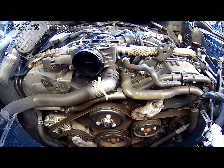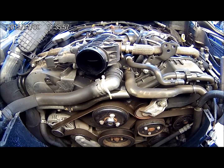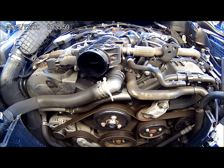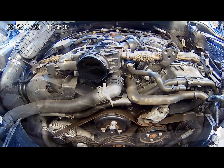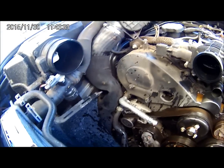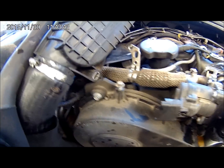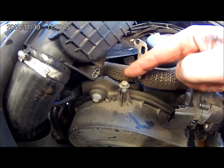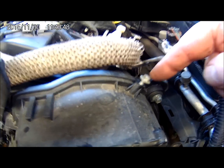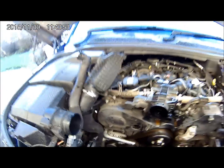I'm going to start removing all the cooling hoses now. You will lose fluid here, but don't worry about it — it's easily replaced. I haven't actually removed them completely; they can be disconnected on one side and just pushed over out of the way, which saves you getting things mixed up. There are also a couple of small brackets just here and here — just remove them off the cover. Again, just stick the bolts back in place so you're not losing them.